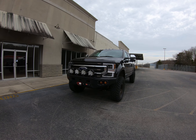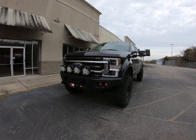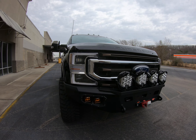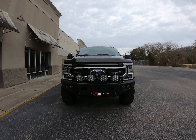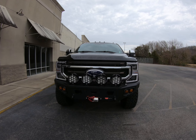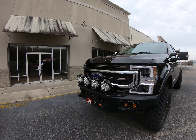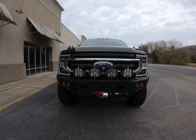It's got Warn front and rear bumpers, a Warn 12,000-pound winch, tons of LED lighting from both Baja Designs and Rigid — Rigid cubes with amber covers over them, and the LP9s from Baja Designs. You'll notice there's something a little different about this particular bumper: with the size and placement of the lights where the client wanted them, we had to get a little creative. Patrick made us a filler plate to mount the actual lights on — it's bolted to the top of the bumper and brings the lights out a bit so they can clear the grille and the Ford emblem. We also relocated the camera in between the lights.